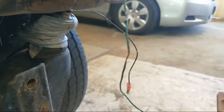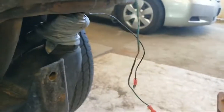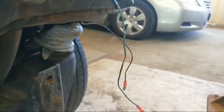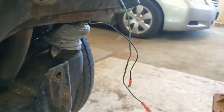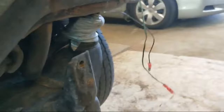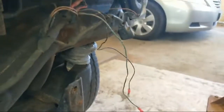And so I replaced that wire with some heavier wires. There's still small sections, but because I can't get new bits to put into the fuse box, I'm just going to have to go with what's there. By shortening it, at least it's less likely to have a lot of resistance. So there's my new wire. I'm going to snip this, put a new wire in here, and that should solve a whole myriad of problems.